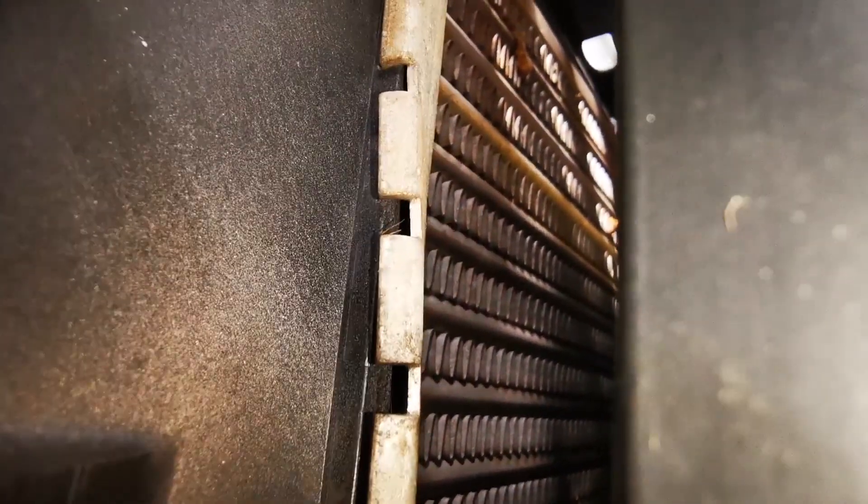I had a good investigation of both pipes. The clamps weren't off and there was nothing there causing an issue. So immediately I wanted to take off the six screws holding down the grille to get much clearer access to the intercooler. Once I had that grille out of the way, in a couple of minutes of looking around it was very obvious as to what the fault was. The intercooler had failed — it had bulged out on one side, it had split, and under load the system was leaking heavily. That's why you could hear it hissing through at certain rev ranges. If you were in limp mode and only keeping it on the lower side of the revs, it would be a lot more difficult to pinpoint that noise.